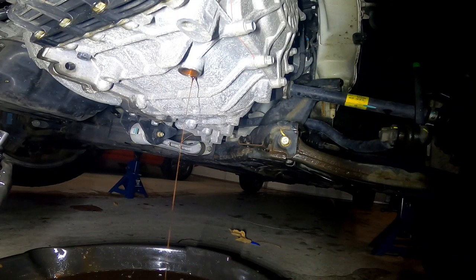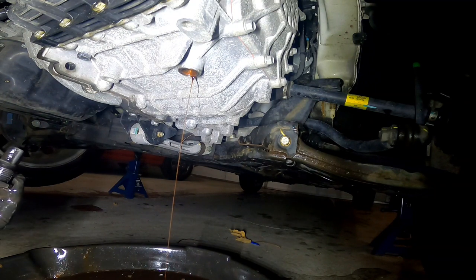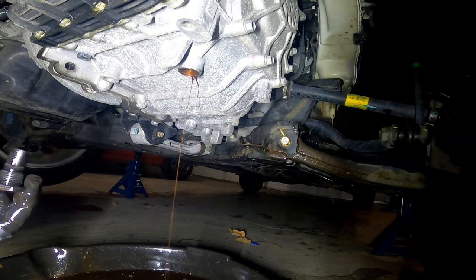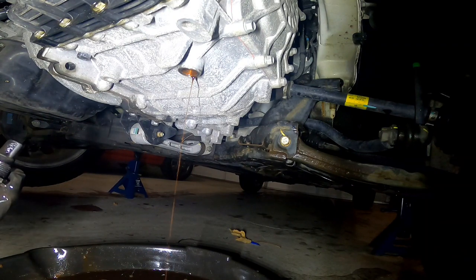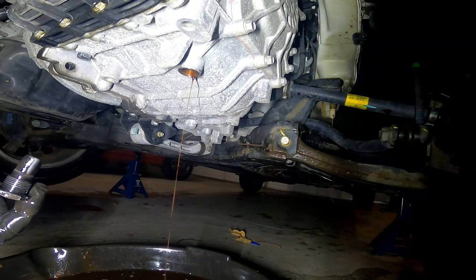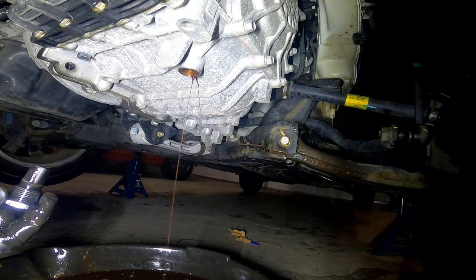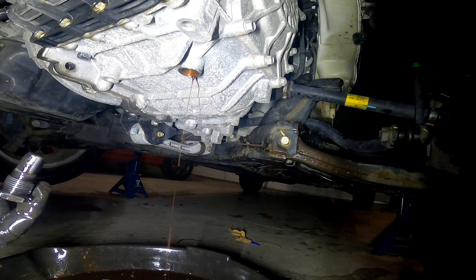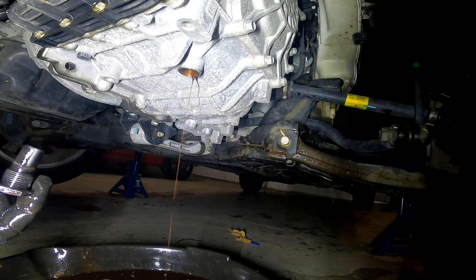I put pressure on the little flap that goes into the pin for the PCM, put it all back together, and got my 0.4 volts back at the wastegate actuator connector. Put it all back together, took it for a drive — check engine light never came back on. It sets a pending code on the first key cycle and an active code on the second. I told my manager it doesn't need a turbo or a wastegate like the other dealership called for. Warranty asked if I was sure — I said I'll guarantee it's fixed, no parts required. Pay me my diag time.